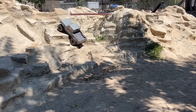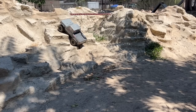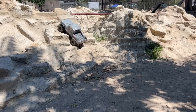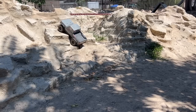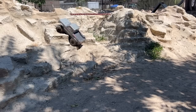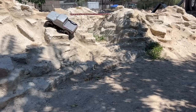The ability to do that right there - I don't think that has anything to do with the compound of the tire. I think the tread and compound are trying everything they can. The foams are just too firm for this application - they're not allowing the tread to work. I would just replace the foams, I wouldn't wait for them to break in. Unless your rig is heavy - if you're a brass man and your rig is like nine pounds these foams might be too soft for you. In the seven-pound-ish range these foams might work. This guy's a little light for it.